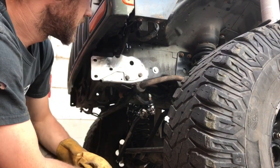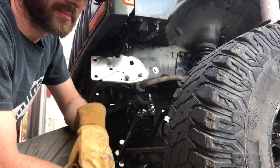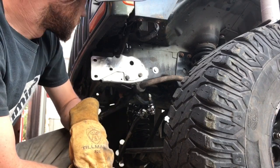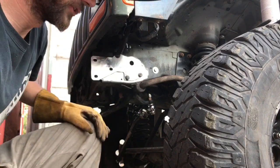I've got my amperage set on level B. It's level 2 out of 4. And I'm going to set my wire speed about 4.5. So yeah, we're just going to burn it in a couple areas, and then I'll probably just tie them all in together.